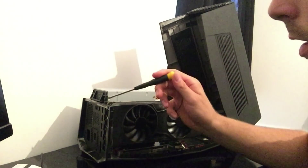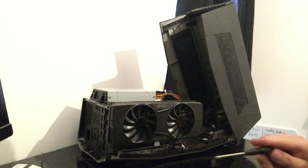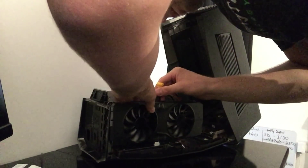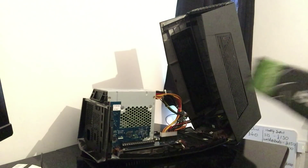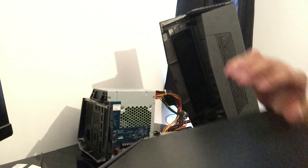I've taken the two screws out of the top here and taken off the power supply to the board as well. When taking out the card, remember you've got a tiny little clip down the back here holding it in — it's very easy to forget about it and trying to yank it out. Make sure that you have somewhere nice to put the card. It's all anti-static and we've got the 980 Ti here, which is still in a box.